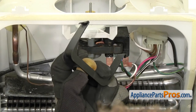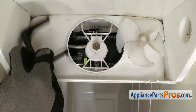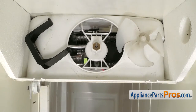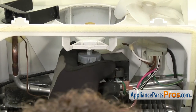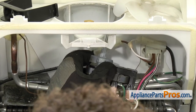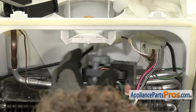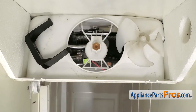You can take the grommet out of it and leave the bracket inside. If you're changing the other grommet, you can pull this down and carefully set the motor down so you don't damage any of the evaporator lines or the fins. Then you can just press the grommet out and pull it out. Now that you have the grommet out, we can pull it out of the freezer.